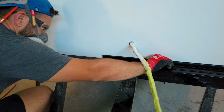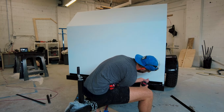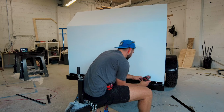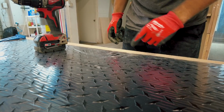I have a previous video about the aluminum installation process, but since then, I've learned a lot about how to make the installation better. In the previous video, I used silicone underneath the aluminum sheets to hold it onto the camper. This caused the aluminum to bend, bubble, and ripple when it got hot. Aluminum expands under heat, so you have to leave room for it to move.